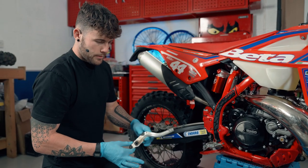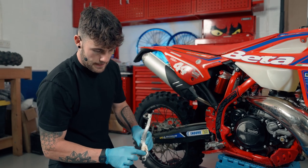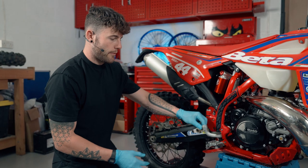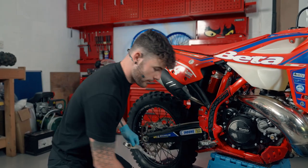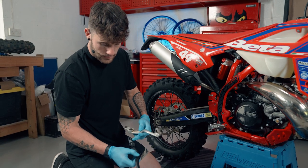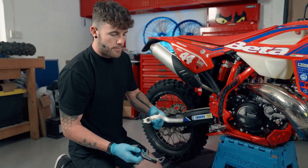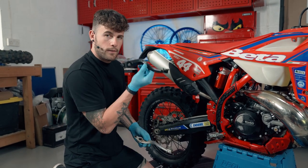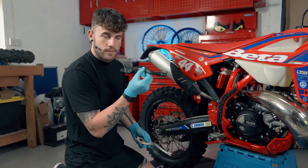Now quite common on the rear brake levers on all models — you can see in here you've got the bearing. They eventually wear down and then you have a lot of play in your rear brake lever. On the new one it's very easy — you can just replace the bearing if you want to, but quite often people damage the rear brake levers: they bend them, they snap them. So a rear brake lever assembly comes complete.